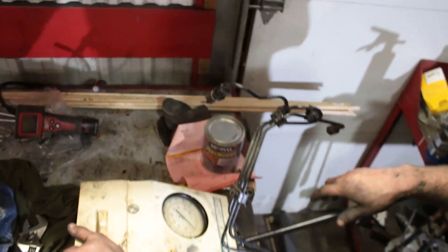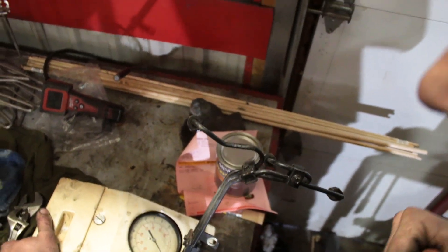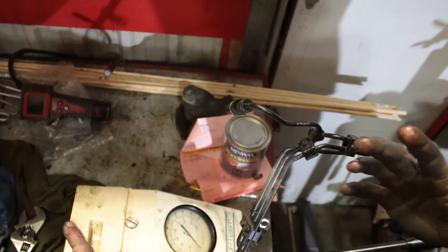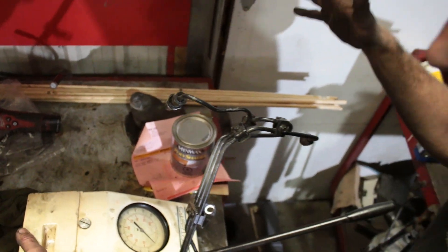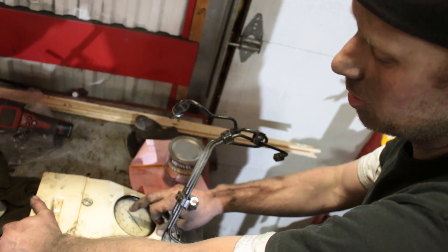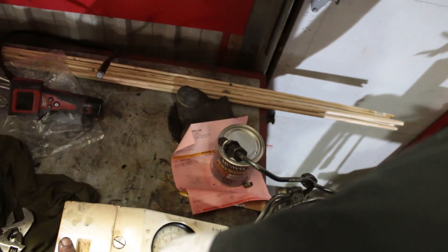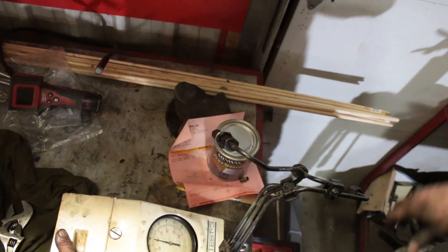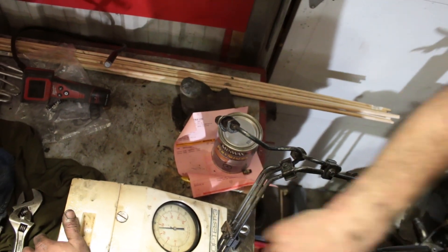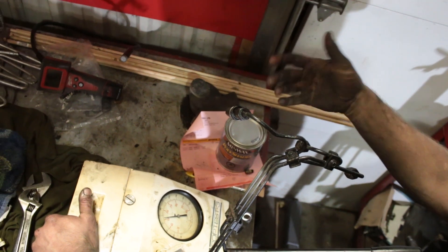What we want to do is lean on the handle and check for a single pop, check the spray pattern, then crank on it really hard and see the spray pattern and make sure that you get a nice steady sound of the popping. Then stop just shy of the popping pressure and check for leak down. A single pop would look something like this. We want to make sure that there's an even spray pattern all the way around — not one longer than the other, not one missing or clogged.